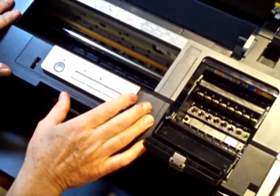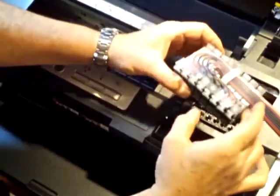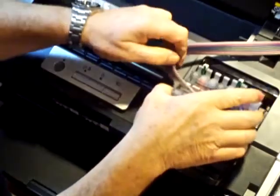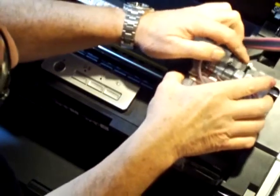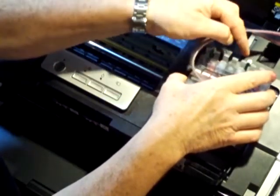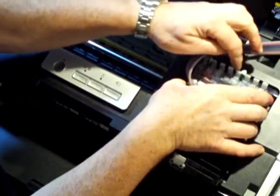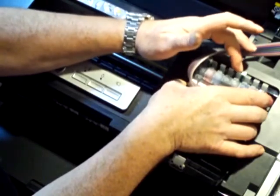This means that for the systems we would fit now - here are the continuous ink system cartridges - you've got eight cartridges in banks of four. The photo black cartridge is fixed at this position. The photo black must be chosen with this system, or you can fill that particular cartridge with matte black, but we don't have the option of changing between photo black and matte black at will.